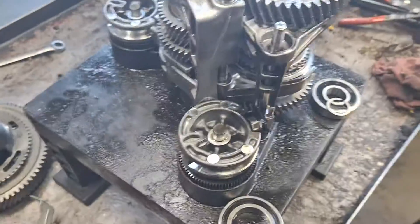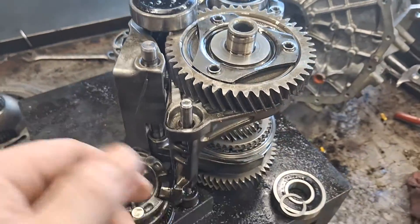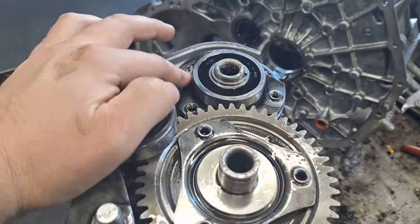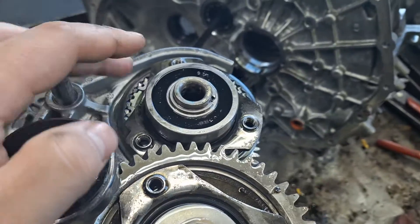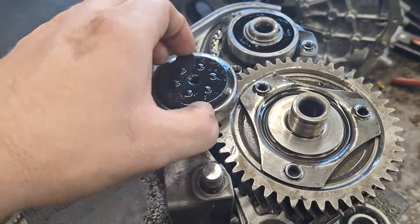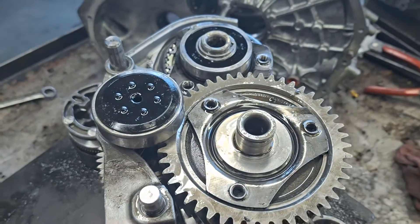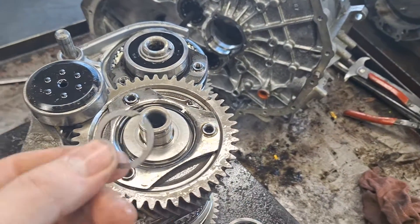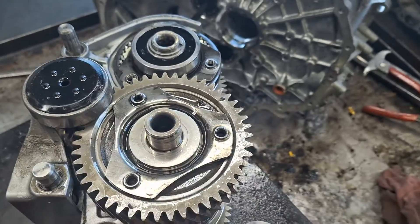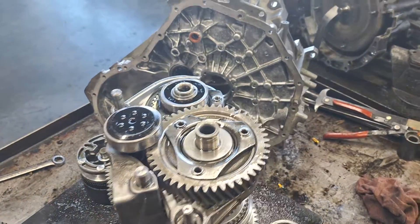I would venture to say if you ever go this far, replace the case, because these shift drum stops shear off — it's about a $400 case half, so it's up to you. Just a quick little video here. The output shaft bearings are Chinese from the factory, and the ones on Amazon are also Chinese — $35 for a 10-pack. You need three of them; I might just replace the one that's noisy. We're either reusing the snap ring or finding the diameter and sourcing one. Thanks for watching, I hope it was interesting — have a great day!